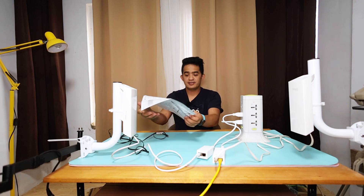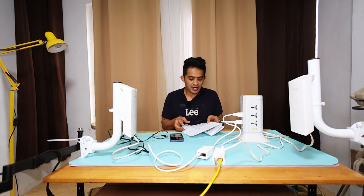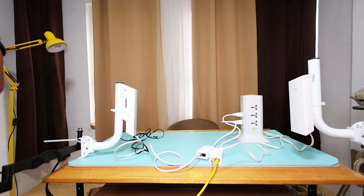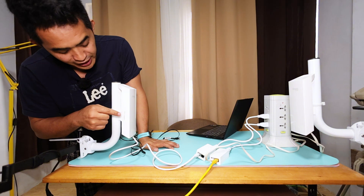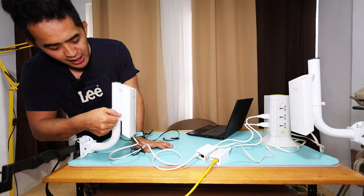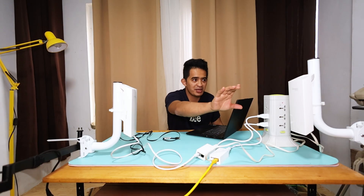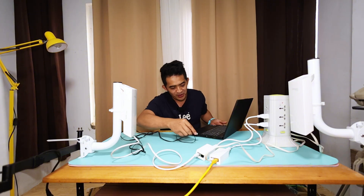We have it here — you would need to install the Omada app. I can also get my laptop in. By this time I should have an internet connection with my laptop if I connect this one. The signal strength is three levels indicated by lights. It has the maximum connection rate here because they are just close enough, but of course if you go further away you might experience one or two bars. Remember, there should be a line of sight so that you will have the maximum connectivity rate. I'll go ahead and disable my Wi-Fi and then connect this one and try to see.